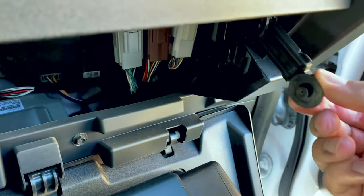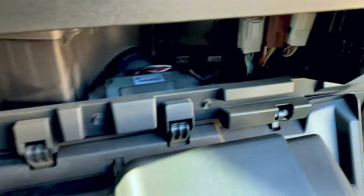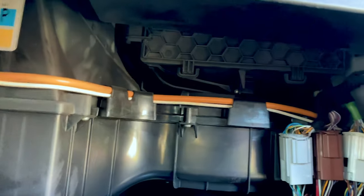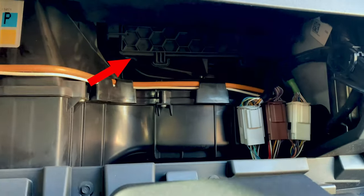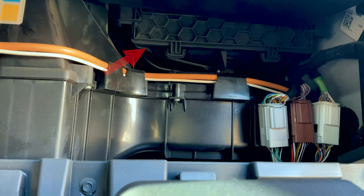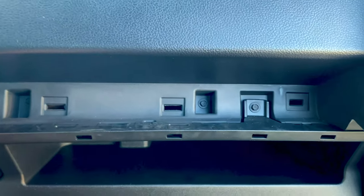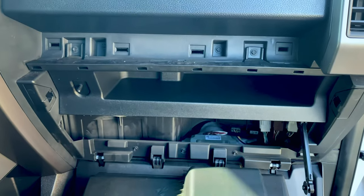You can see how the dampener is on the gear and it just slows it down. When you're looking in here, the cabin air filter is in there — that honeycomb-looking spot right there — and that face just pops off. But we can't really get to that easily because this is blocking it. So we're going to remove this bolt, this bolt, and that bolt, and the whole front is just going to pop off nice and easy.